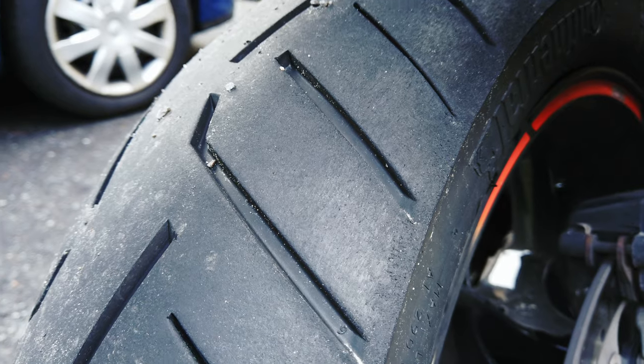The second thing that's quite important: if you do a lot of street riding, the selection of tires available for the 19-inch front and 17-inch rear is much larger, especially tires geared toward on-road riding. There's a really wide range — from 60/40 off-road-capable tires all the way to near-racing tires. That size gives you far more opportunities in picking the right tire for whatever you're doing. For the larger 21-inch wheels, the road tire choices are there but limited compared to the smaller wheel size.